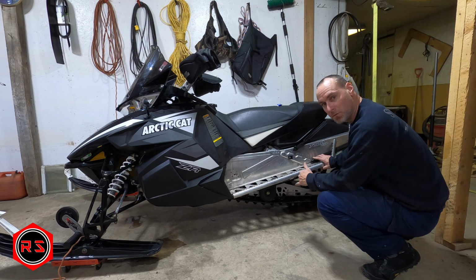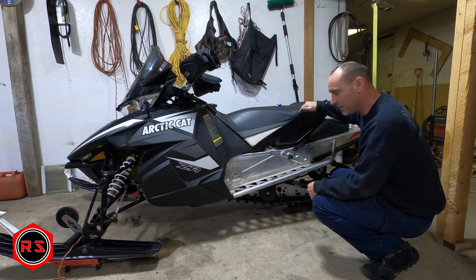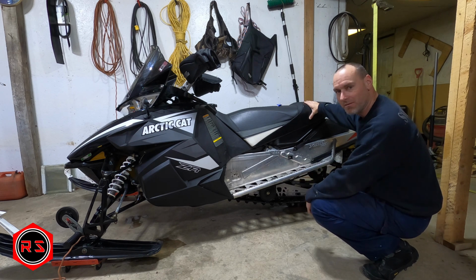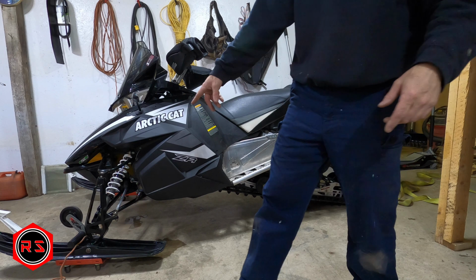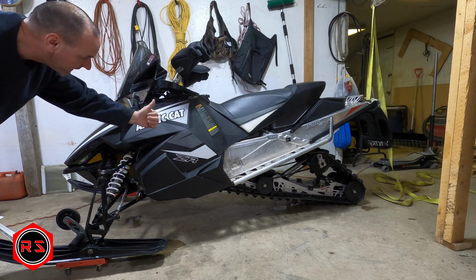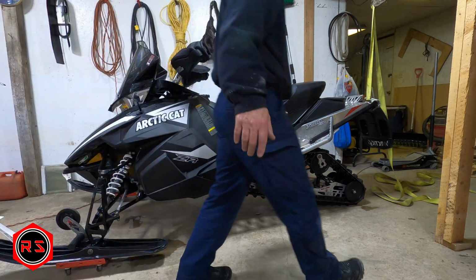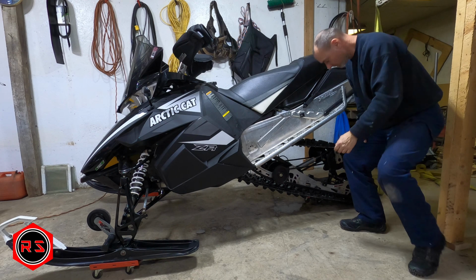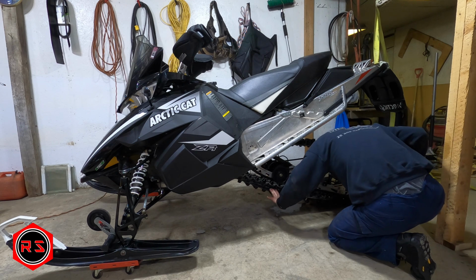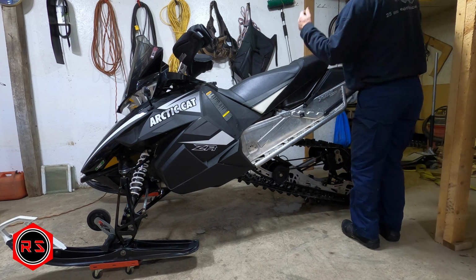So now that the bolt is removed on both sides, the next step is to raise the back of the sled at least 3 feet high, but we will know when we have enough slack to pull this thing out of there. Something that helped is these little dollies in front, because as the back is lifting, the front can back up a little bit without scratching your floor. It's almost off by itself, so I will raise it again.